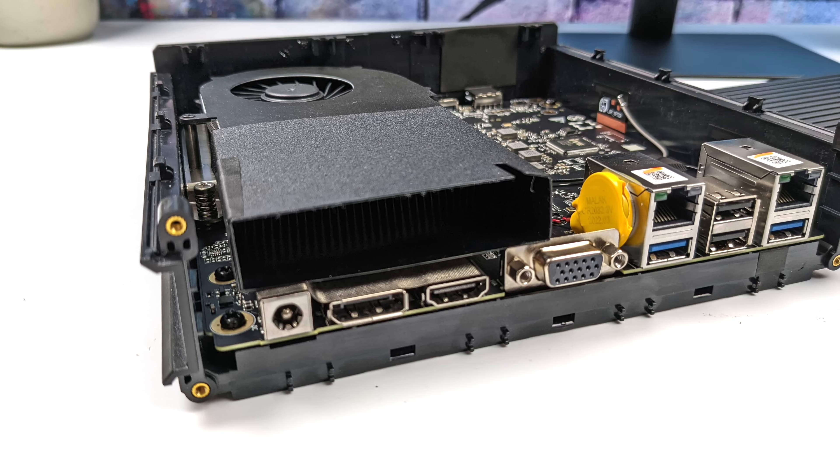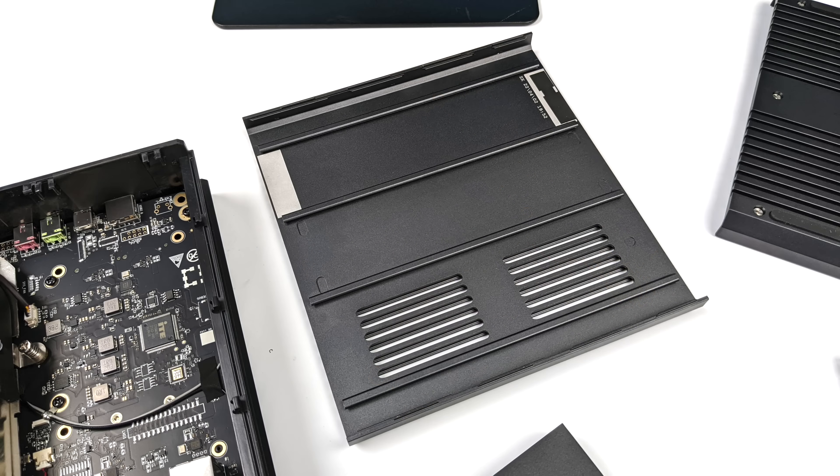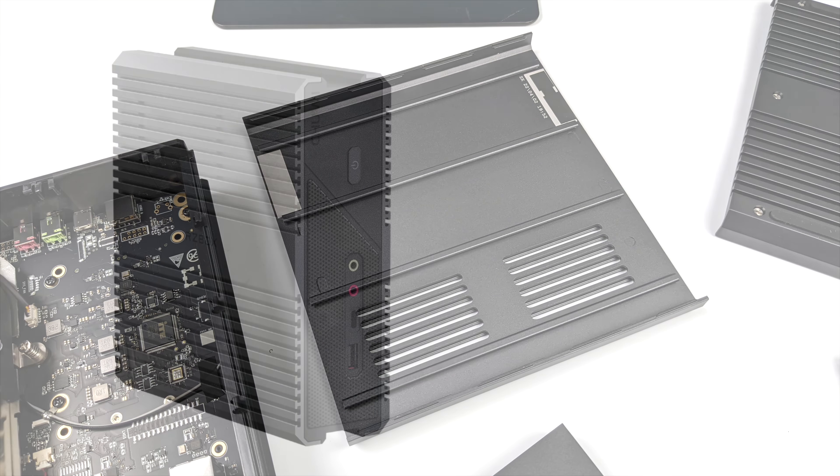Unfortunately the top and bottom aluminum isn't utilized to cool the CPU. With the original RZ box it did get a bit hot with the 4800H, so I was under the impression the cooler would have been upgraded in this model. If you pull the black plastic shroud off you can see they had plenty of room to add a longer fin array, and they could have used this cover to help cool the whole system. There's plenty of aluminum here to extract heat from that APU.